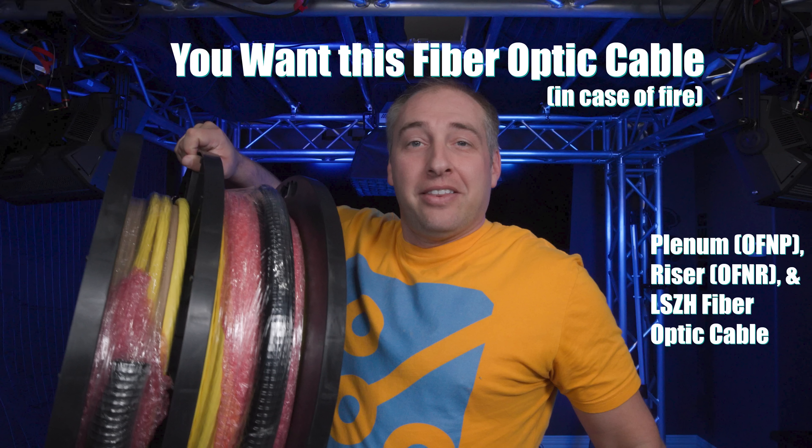We are doing a giant series on STH around fiber optic networking, so definitely check out the STH main site. Aside from optics, you can also use DACs — direct attach copper cables — which tend to lower the cost of connecting devices significantly. We buy a lot of our DACs for maybe $20 or so. DACs have two ends — say, SFP28 or QSFP28 — you just connect them into your server and your switch without needing two optics plus fiber cable. They also tend to be lower power, so DACs are a total win if you can use them.